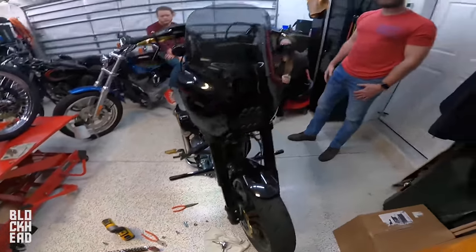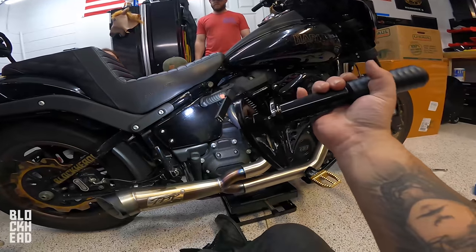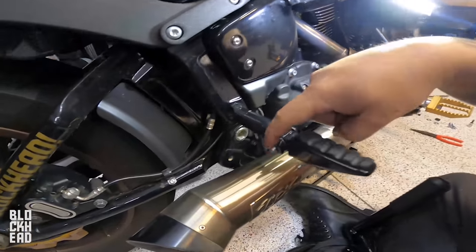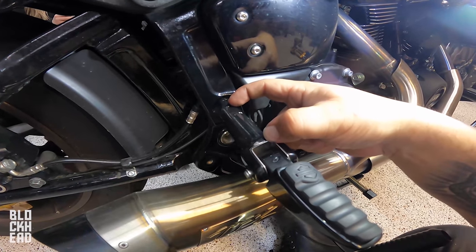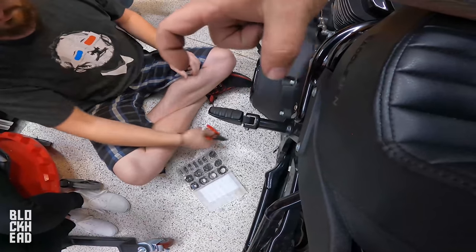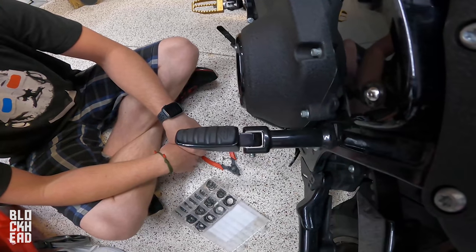Should we do the back ones? Let's throw them on and see what they look like. Alright, let's do the back ones — unpackaged. In order to install the rear bike guard and exhaust guard, it looks like we do have to remove the passenger pegs. If you don't have passenger pegs you don't have to worry about this part. If you do, you basically remove the retention ring, remove the clevis pin, and then the bracket. There's a long bolt that keeps the piece on. Do that same on the other side. Well guys, we've reached a stopping point — the torx bits I have don't reach far enough back to engage the bolt heads, so they were just barely missing. Not worth rounding them out, so we'll just be patient and continue that job later.